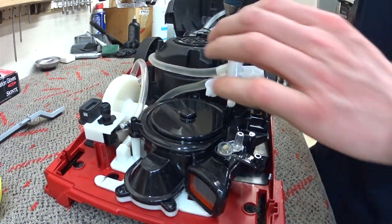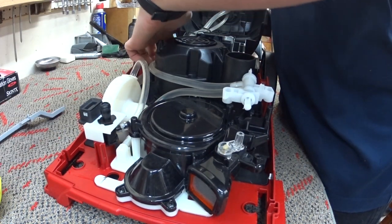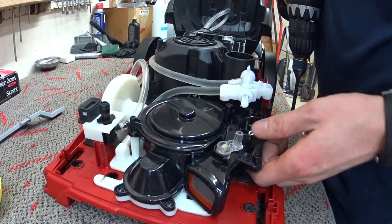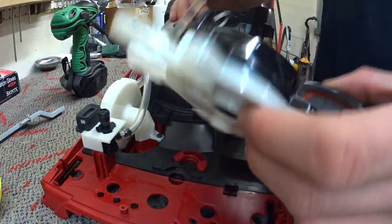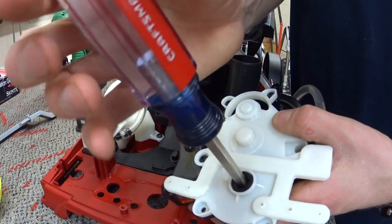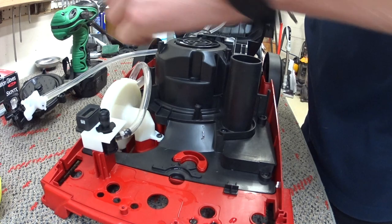This is where a new tech I was training had trouble — there's just a screw here and a screw here on the motor housing. He used to skip those and end up breaking the motor housing, which we replaced for the customer. There's one more. Everything's black and it all blends together in here. There's a turbine, and these turbines should spin pretty freely. If they don't, they either need to be taken apart, cleaned, and greased, or replaced.